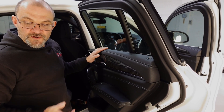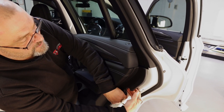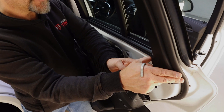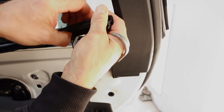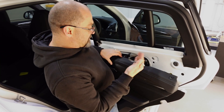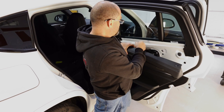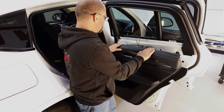I'm going to use this for window tint purposes, so I'm going to grab a hook. Be mindful — like in the last video — you've got this door lock rod, lift it up and just gently swing it down. Lift the trim up and away. For window tint purposes, just get this little plastic housing here, move it out the way, lift your hand up, put it on the other side of it and then twist back towards you, then lift up and slide back. Once you've done that, grab one of these little S hooks and hook it on there. Make sure the S hook has a nice tight curve in it, because if it's bent out too far and you hook it in, the edge of the hook can scratch the glass. Hook your trim on and you're all good to go.